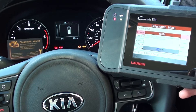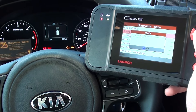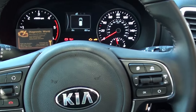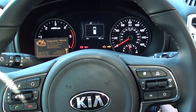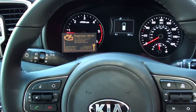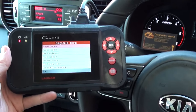I'm going to click OK on the screen here, and it's telling us emission-related diagnostic information has been cleared. You can see the light is still on — all we need to do is simply start the engine, and we should see an end to the check engine light. There we go, it's all gone — great news!